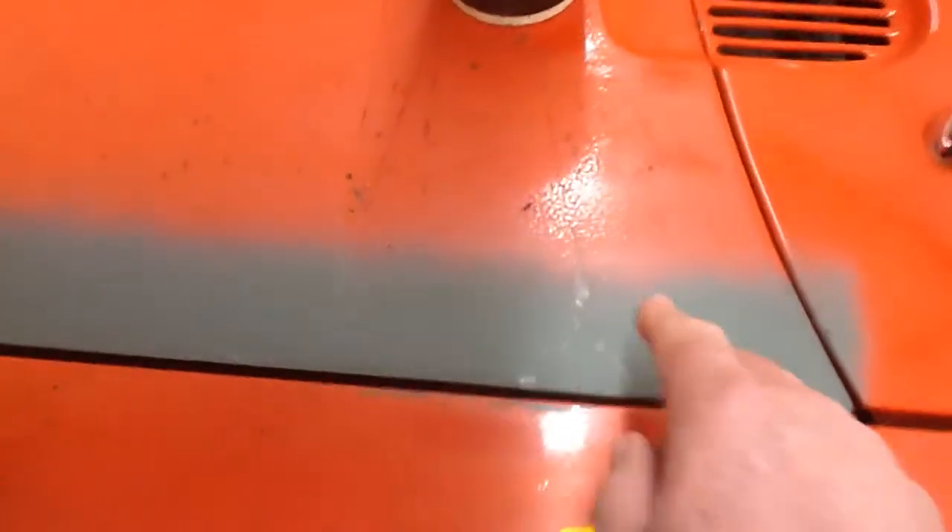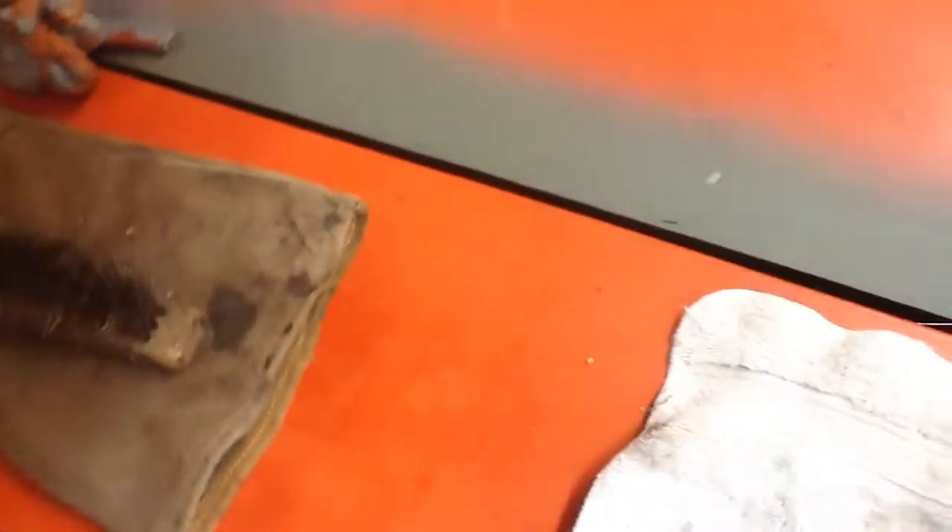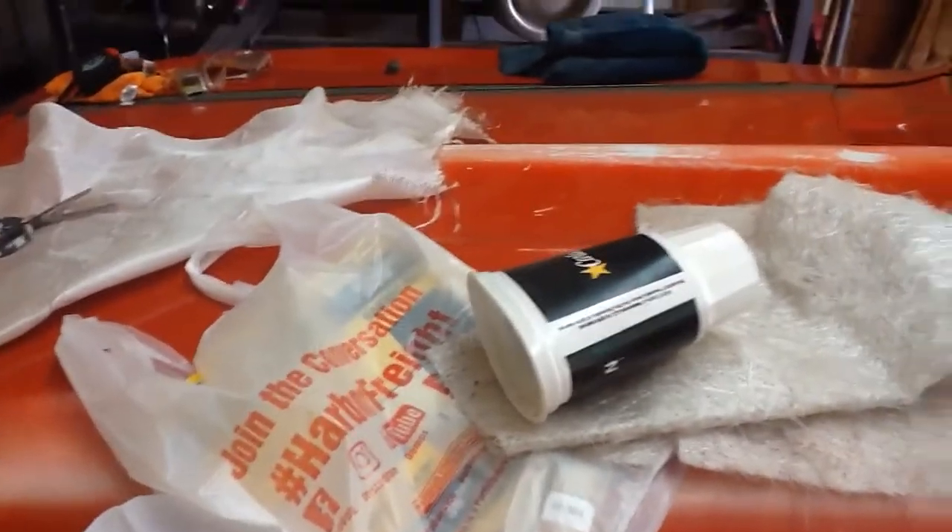I finally gave up and ended up welding — I've still got Bondo to do — but now you see the gap is nice. I had to weld a small rod to the edge of the door. Same thing with the hood on both sides: one eighth inch on this side, and then on the other side it was more like three sixteenths to get the gaps right.